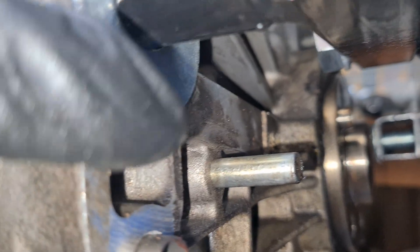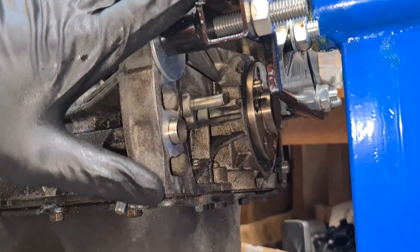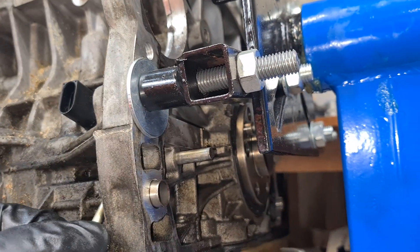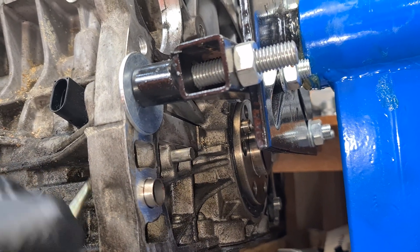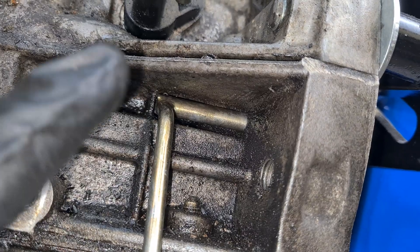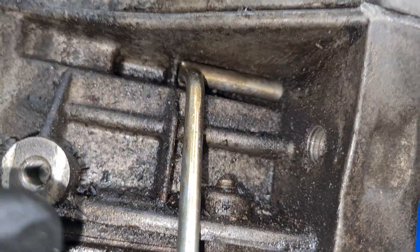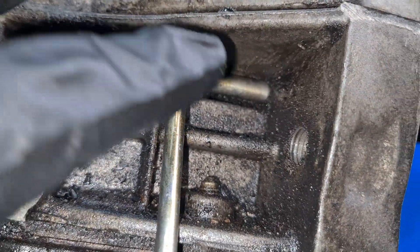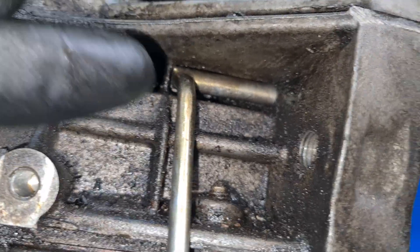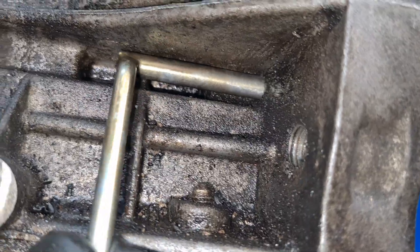Once that is done, you should have the crankshaft locked. Sadly, I don't have the flywheel for this engine, so I can't show you on the engine stand. Again, this is where the pin has to go, and it's quite fiddly. First, always start with a decent amount of WD-40 or some kind of grease to clear out the debris and the dirt, because this gets full of dirt and then you are not able to insert the locking pin.